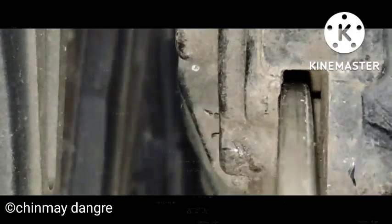The disc is on the right hand side — it's not in the center. Within the rectangular shape of the caliper, the disc has to be in the middle, not towards one side. As you can see, it's on the right side of the caliper, so it's scratching, and as you can see, the shape has also changed.